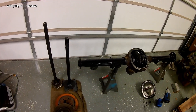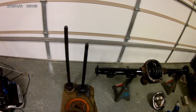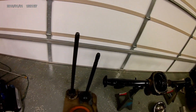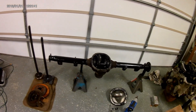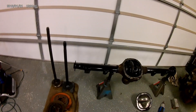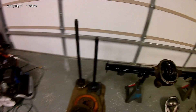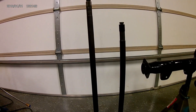Originally this rear end was about 70 inches wide — 69 and 7/8 or something like that from flange to flange — and I took 10 inches out of that, so now it's 59 and 7/8, almost 60. My stock rear end was 59 inches. I've got an eight-and-a-quarter that I measured, but I'll just show you the difference in these two axles — your stock Crown Vic axle versus...